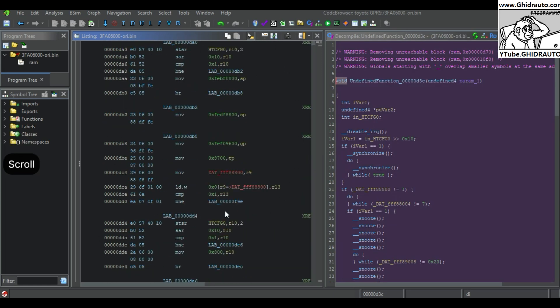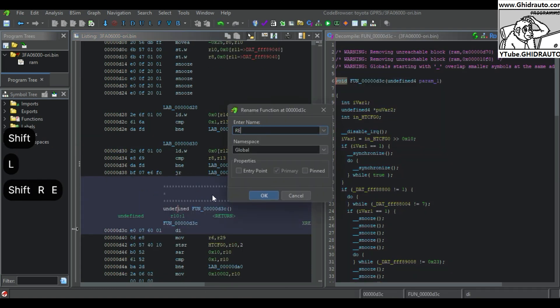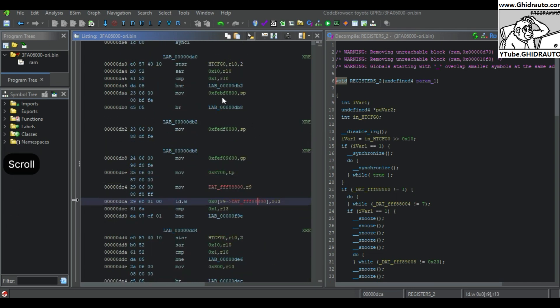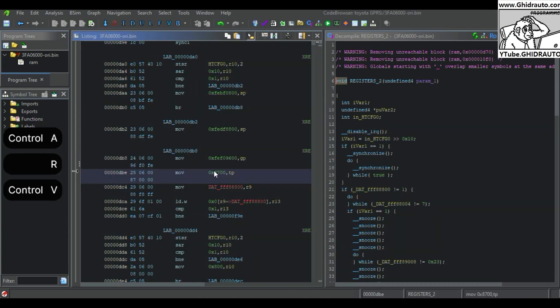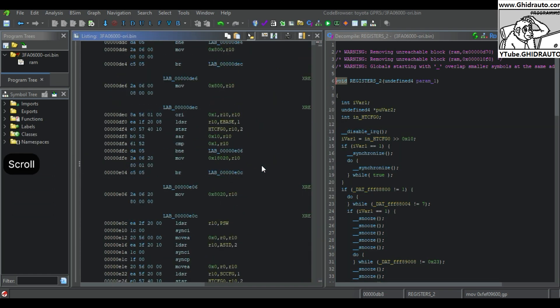Here is our second set of registers — we're going to call this 'registers two.' The Gen 3s are a little different: you'll see that SP is set to this address right here and then set again to this address — you kind of have to take a guess at which is the right one. This is the one that I use. Then GP right there, TP right there — we don't have to guess about GP and TP because each is only set once. And then r11, r12, and r13.